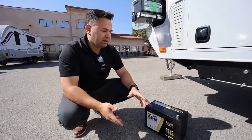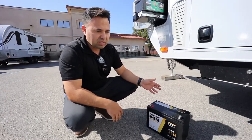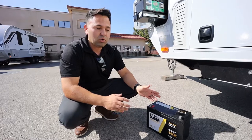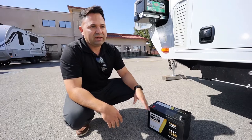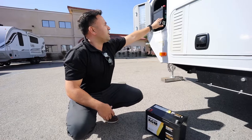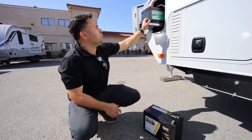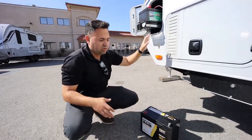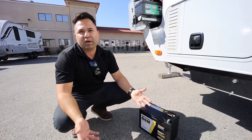With lithiums, you have to be a little bit careful because in extreme temperatures — above 130 degrees or in real cold temperatures like below freezing — they might not take a charge. That all depends on the placement of the batteries. Here you can see the batteries are outside somewhat, so that might affect the lithium battery in extreme cold or hot weather. But on some units, like our campers, the batteries are actually installed inside a compartment, so the weather really doesn't affect it, and you can decide to go to a lithium battery.